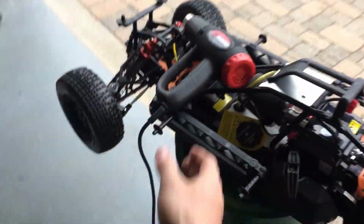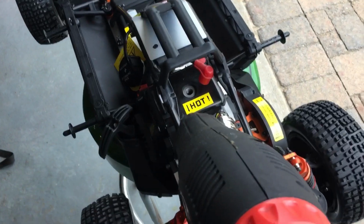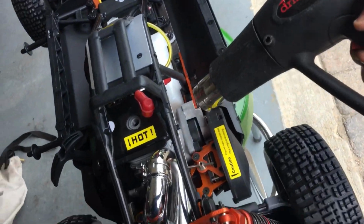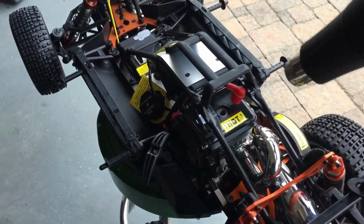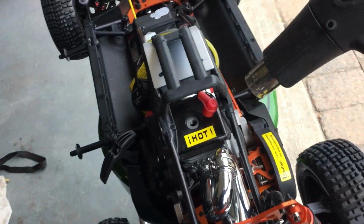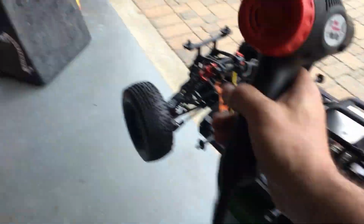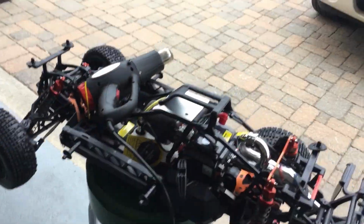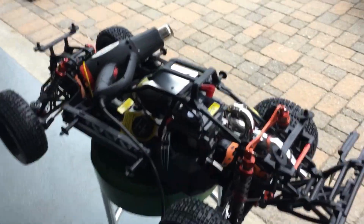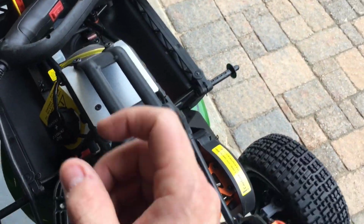From there, you're going to heat up your motor. Go around, don't stay in one area the whole time, top, all over. Don't stop until you reach 180, 150. If you find yourself at 200, don't worry about it, stop there. Do not pull on your motor, do not move that piston until you have oil in there. You don't want that scratching up.